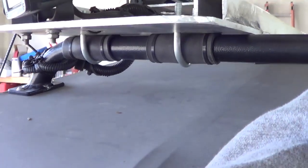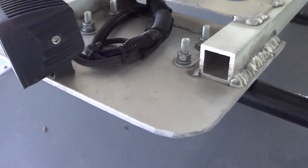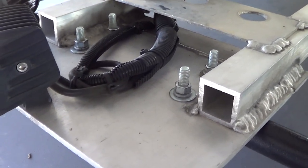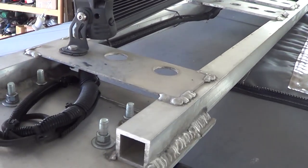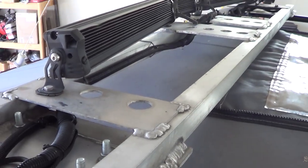This whole thing is attached to the grab rail with U-bolts. They're galvanized, not stainless. I tried stainless at first, but they tend to gall up — they'll jam up and you won't be able to take the bolts off without cutting them. That's just kind of the way stainless is. So if you want to install it and leave it there forever, stainless will work. But if you want to be able to take it off, go with galvanized.